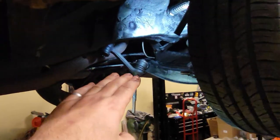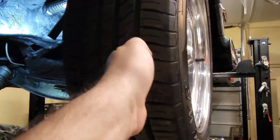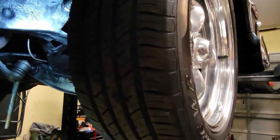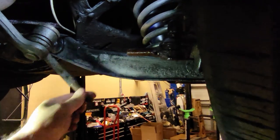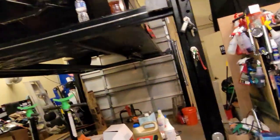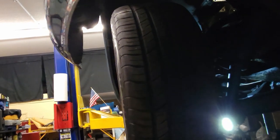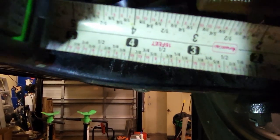I was told online that the tie rod ends are too long with the new drop spindles and you can't adjust them — you gotta adjust the back side of the tire in to get it straight. I got it straight, and when I took the sleeve off and measured it there was an inch and 13/16ths between the two tie rod ends — the inner and outer. I didn't film it so I didn't show you. The tire is pretty straight now — gonna have a little toe in, and that's fine. I'll give myself maybe a quarter inch extra to play around.